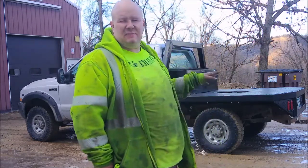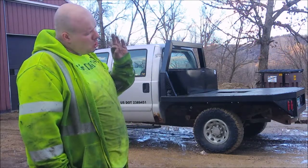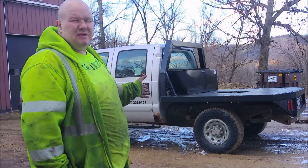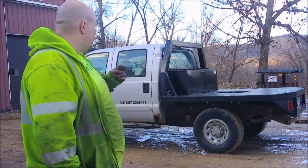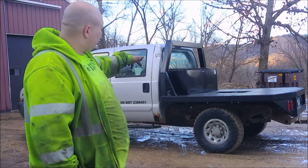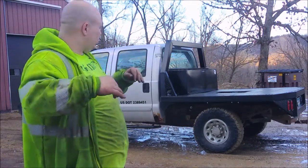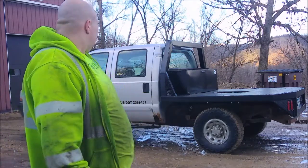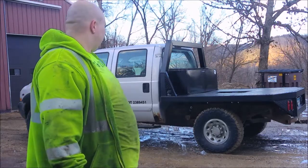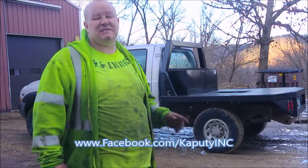Well, that's going to do it for my flatbed build. It turned out pretty sweet — I like it a lot. We got LED tail lights, LED backup lights. Everything's built out of eighth-inch steel. Headache rack, fuel tank, filler neck — tried to fill it with fuel, works sweet. Maybe add mud flaps later. Got to see what the policy on a bumper is — but that drop-down piece is what I consider the bumper. It's got the gooseneck ball on the deck. The D-ring is actually attached to the side of the bed, so if the gooseneck ball portion were to fail and fall out, the rings would still be attached to the bed — mounted essentially to two different places, which is safer than having it all on one plate. We're going to add some lights to the top eventually. Hope you liked it — please subscribe, feel free to comment, and check us out on Facebook. See you on the next one.